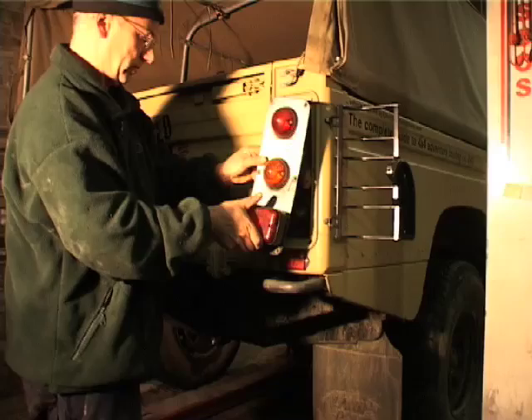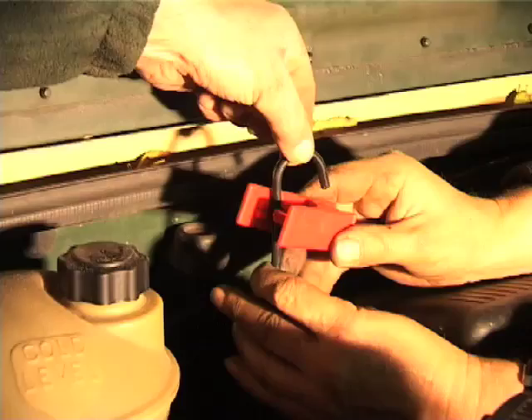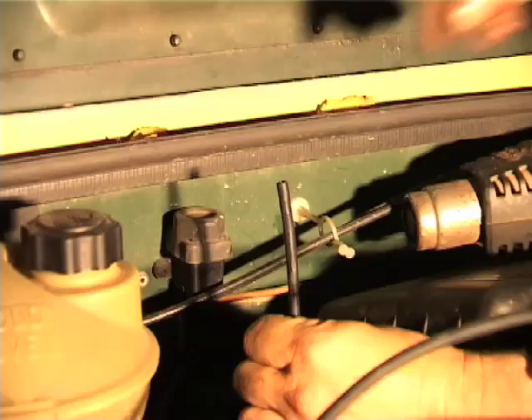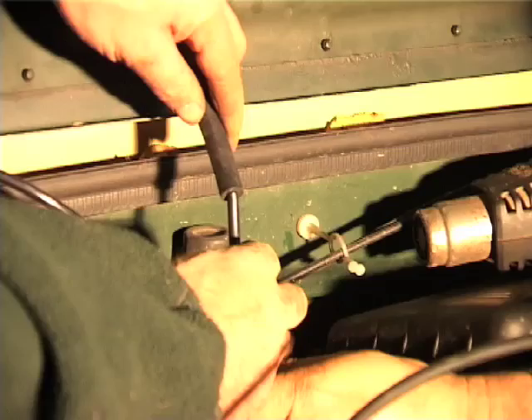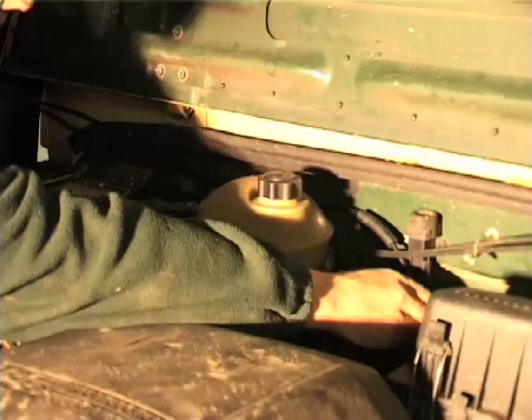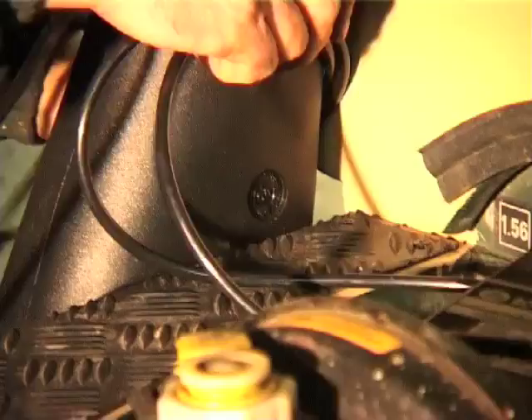We take it right up to the top where the bolt fixes onto the upper hood stick. Always make sure you're allowing enough slack in the breather pipes for any articulation when the vehicle is off-road. For the gearbox and transfer box breather pipes, cut the tops off just below the hoop where they curve over. Then use a hair dryer or paint stripping gun on a very low setting to heat the tip of the hose so it becomes pliable and easier to insert into the hose connector on the extended breather pipes. We pass both along the back of the bulkhead, running them underneath the bonnet gutter at the back of the bulkhead, then over the top of the wing and around the back of the air intake.